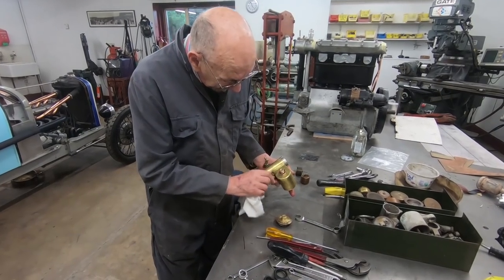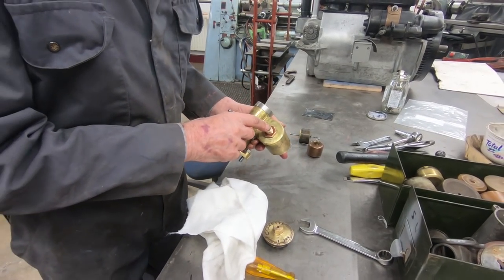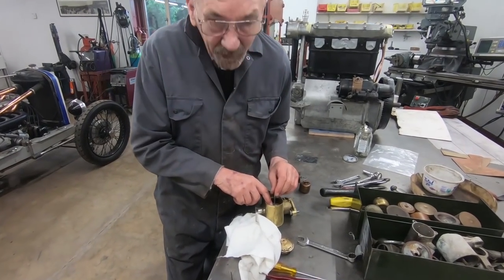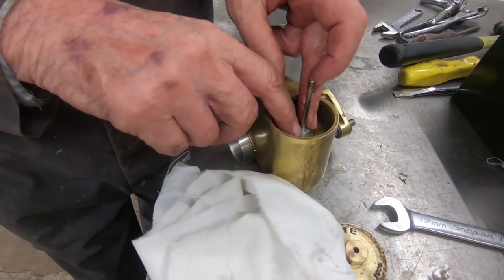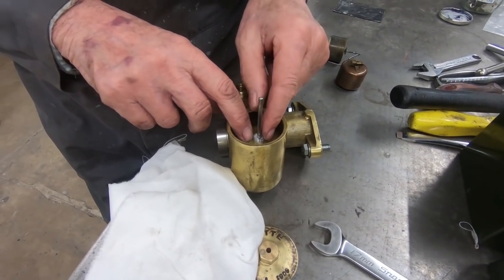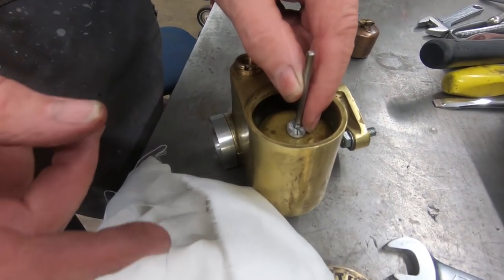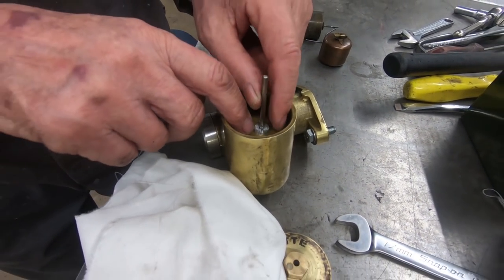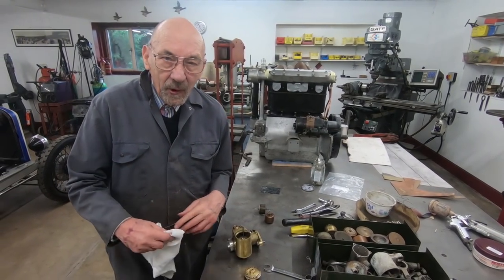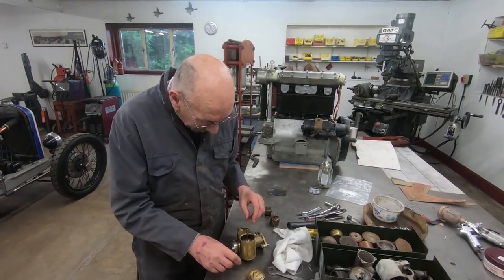So we've altered the main thing here that when the fuel goes in, and we've made the tapered needle valve, and then we've joined it to the Jaguar float with a little aluminium spacer, and then we drilled a hole in the thing and put a pin in it, and to get the float level right, we just make up new ones of that little spacer. I mean, obviously you could put washers under it, but we just make it up, because we could make something that's fitted to the float. But in my experience, the minute you touch a float, it starts to leak, sink, and you have nothing but trouble. So all this modification's been done without altering anything, really.